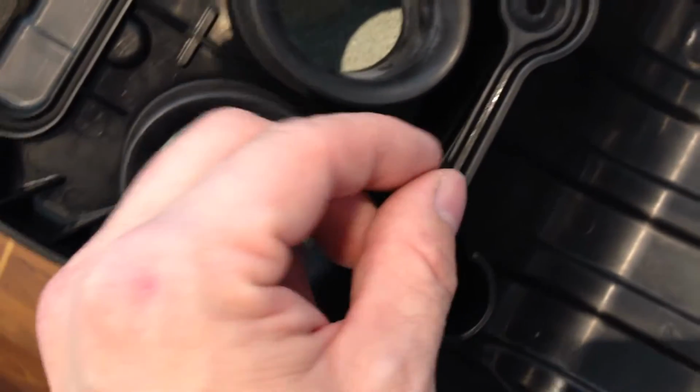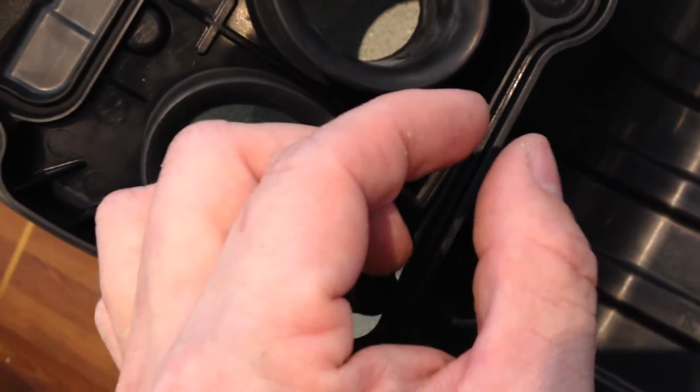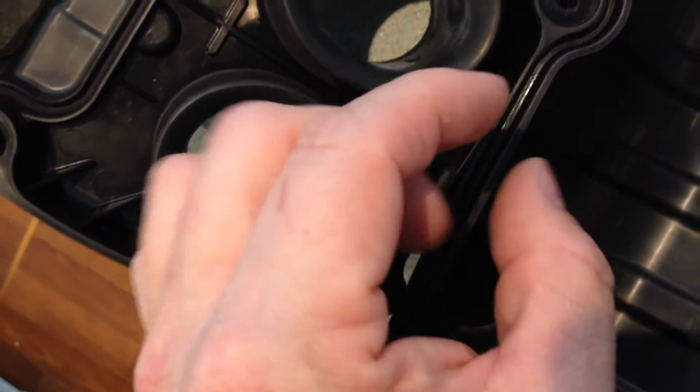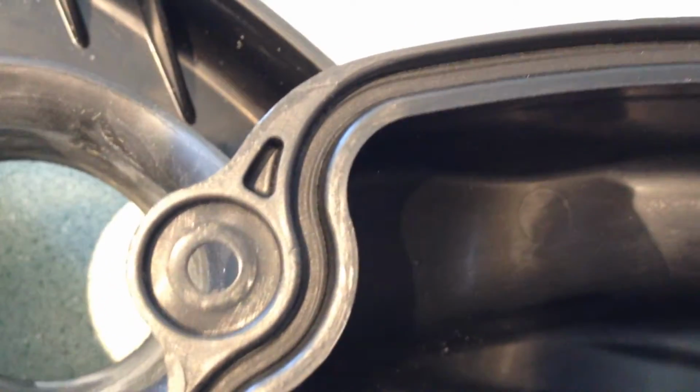And when you place it in, make sure that the flat side is up. Don't have it on its edge, because the edge is narrower, so it doesn't fill the gap, and don't have it rotated and twisted in multiple locations. Just make sure it's nice and even, just like this, everywhere, all around. So this is the gasket in the upper half. It needs a little rotation there, it starts to move. I'm going to adjust it a little bit, maybe there, a little better. Anyhow, just be careful with this rubber gasket, same on the other side. So that's how it goes together.